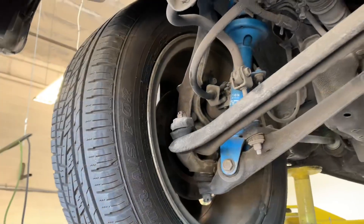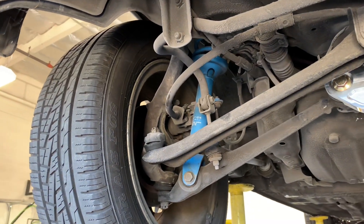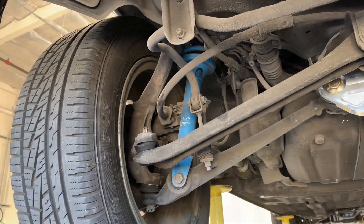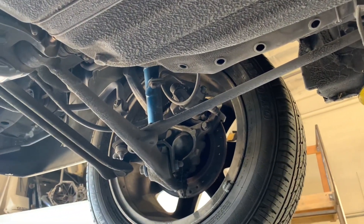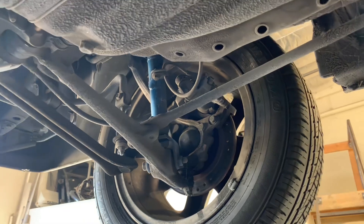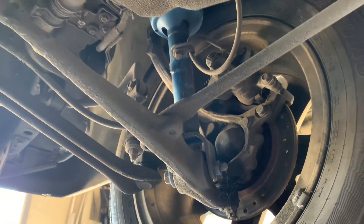This is most likely done by Honda because this car was also available with four-wheel steering. The whole rear suspension of this car almost looks like the front suspension of a normal Honda — it has a tension rod setup, it has a toe link, and the spindle itself looks like it could actually receive an axle if you wanted it to.